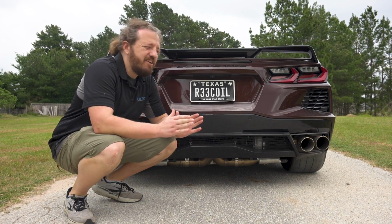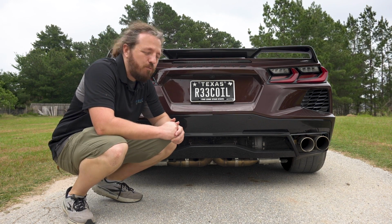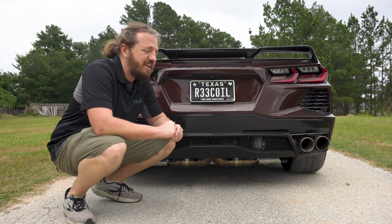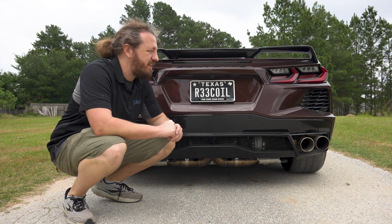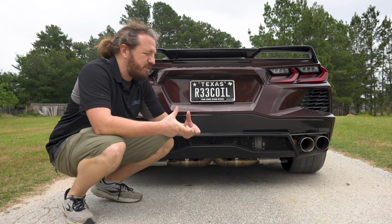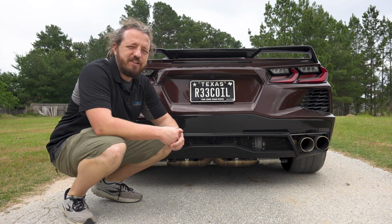All right guys, here is the turbo kit. We love our Precision 62, 66 millimeter turbos with our X-pipe. We're the first with an X-pipe on the twin turbo C8, and we really like that design a lot. These are in-house made tips. We turn those on the lathe. We have rings that we machine, and then we weld it all together, turn it down. They come out really nice.